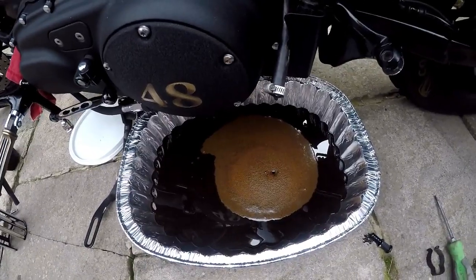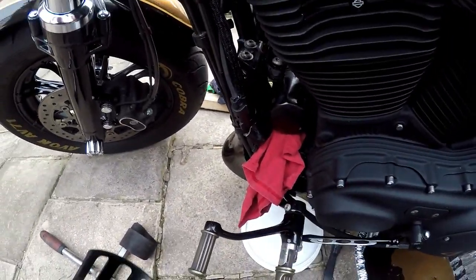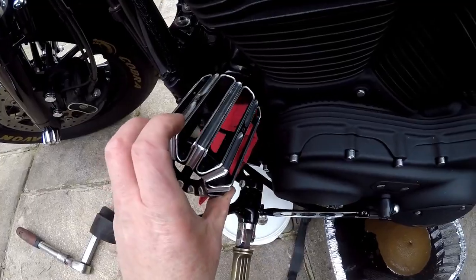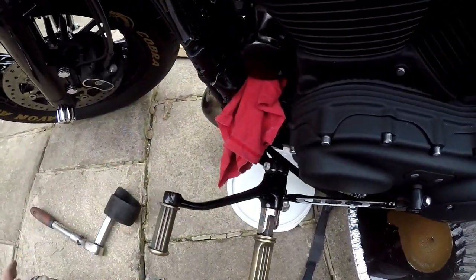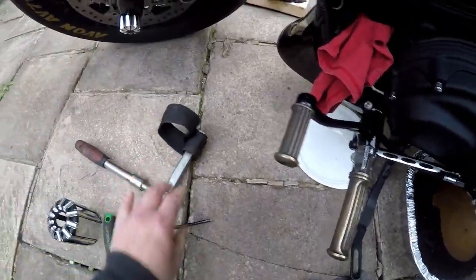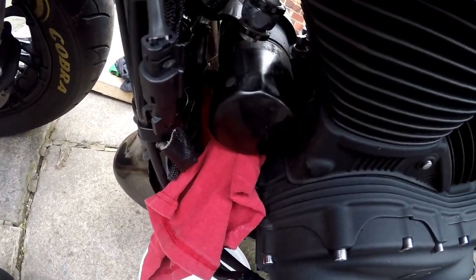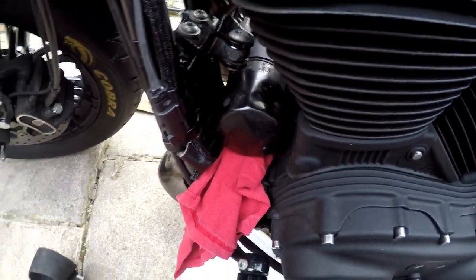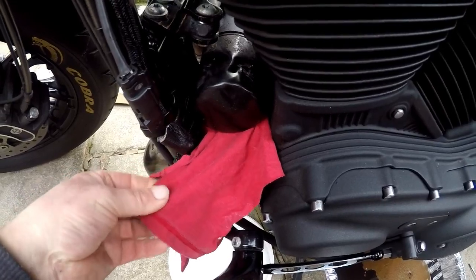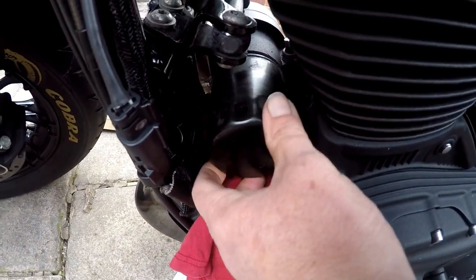We're nearly there with the oil now, just barely a drip. Oil filter — I have an aluminium cover on mine, nice little cover, available in all various styles. It tightens up with two little Allen grub screws. What I've just noticed is I've used the filter strap on a ratchet to take it off. Whoever did the 1,000 mile service overtightened this filter — she was well too tight for the bike. Okay, we can get it by hand now. The reason I always carry rags is to put a rag underneath to catch any residual oil coming off your filter and save it going on the side of your bike and all over the floor.